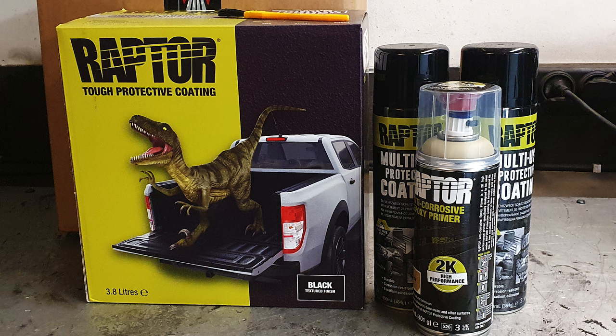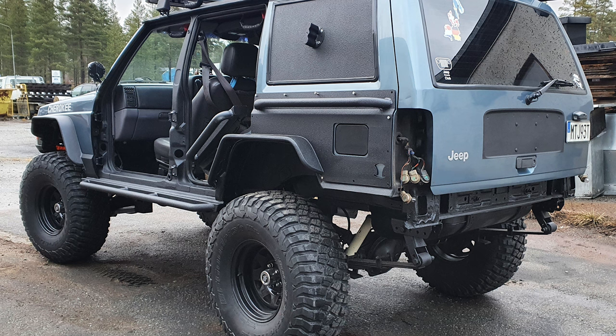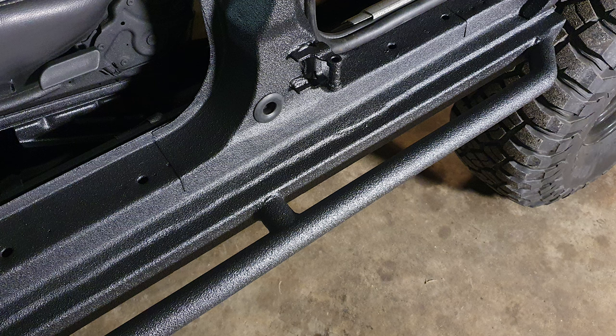I'm using the Raptor liner two-part epoxy primer. I've had really good experiences with that. I've done the gullwing windows, I've done the tube sliders, which I stand on all the time, and sometimes I've got stains in my shoes and everything, and they've held up really well. And it's really just down to putting that mechanical key on the surface and spending a bit of time doing it.